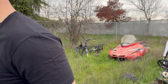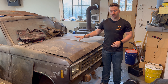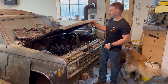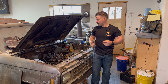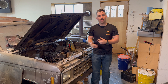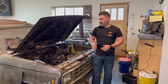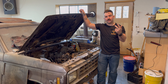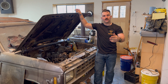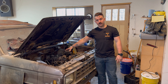Let's go inside — it's chilly out here. This is my 1987 Ranger. I drove this in high school; anybody that knows me knows this truck. This is my baby and I'm glad I still own it. It caught on fire about two weeks before I joined the Marine Corps, and it still ran but pretty much from the transmission back it had to have all new wiring, hoses, lines, everything. The plan is I have a solid axle Dana 44, a shortened Dana 44, sitting in the back of this. I'm going to get either a Dana 60, a Ford 8.8, or maybe a Ford 9-inch for the rear — just depends on what comes up. I'm going to tear this engine out and put in the 302 with the EFI kit, and we are going to make this a five-speed instead of a four-speed.